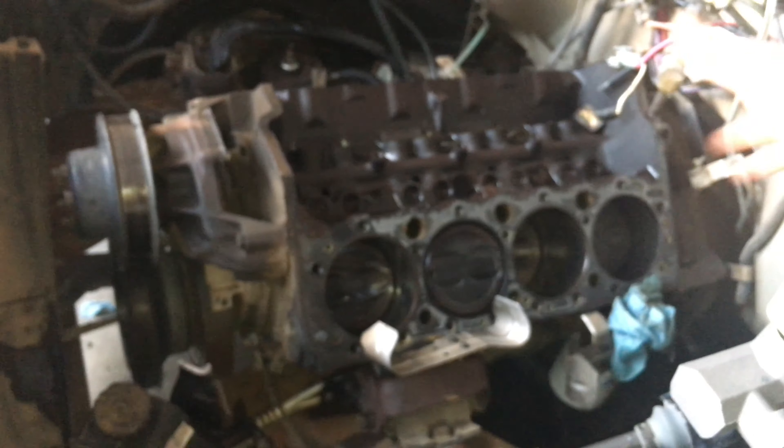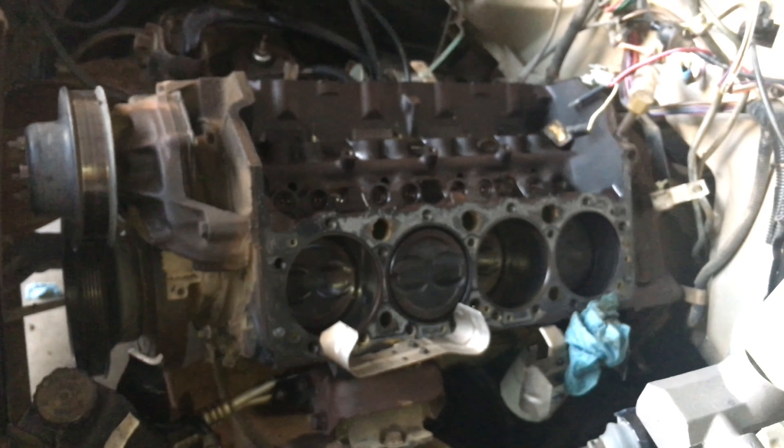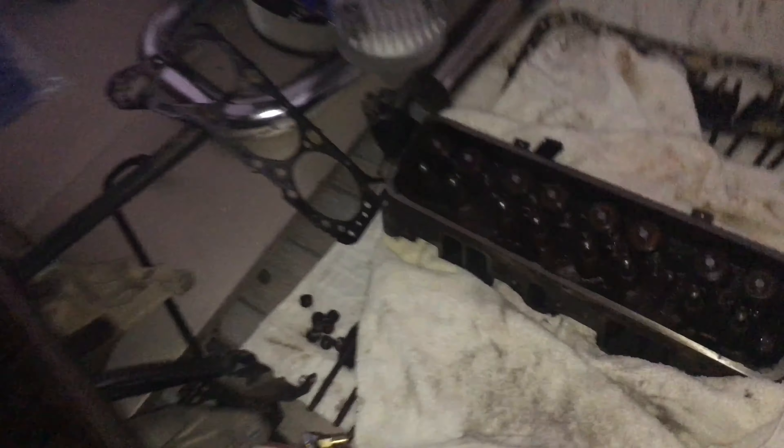We're gonna pull these pistons out — I actually ordered some new ones, they should be here within the week. I got everything stripped out. I'm gonna pull the block and leave the mains, leave the crank in — just pull these guys. I'm gonna reuse the bearings that are currently there unless they're grossly out of spec. I'm just gonna do this all cheap, get it back together. We'll be ordering aluminum heads before too long, but we're gonna do this like we're super duper broke — cause I am.